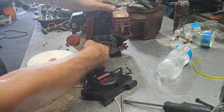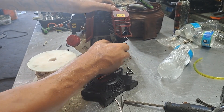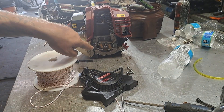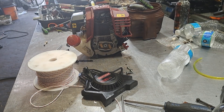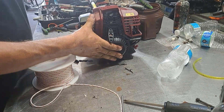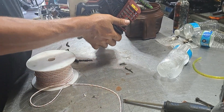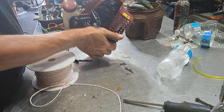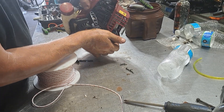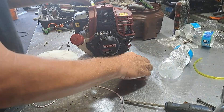These little flipper thingies — those are called pawls, P-A-W-L. If you need these ones, I'll see if I can find them in the description. This is going to be the same as an Echo backpack blower. Pull on it a little bit to get it to drop into place — there it goes, dropped right in. Make sure you get the plastics lined up properly on it.